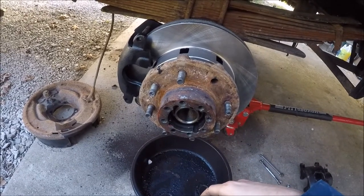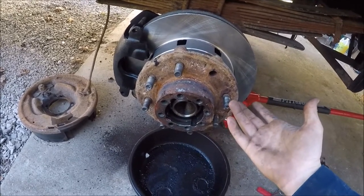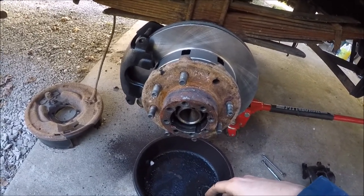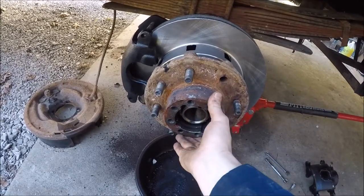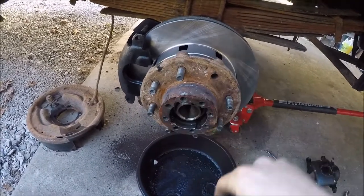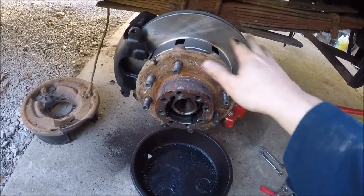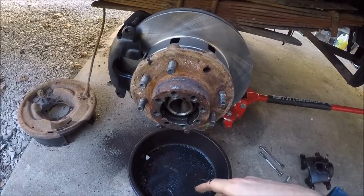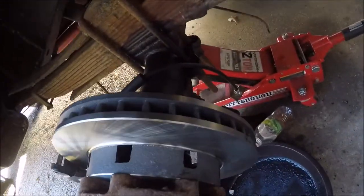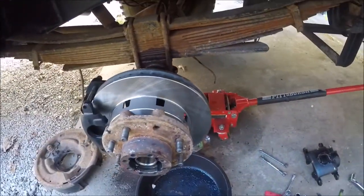So I'm pretty excited about this. I've pretty well decided I probably won't film the other side because it's the same exact thing, just mirrored, and I'm not going to make everybody sit through that. What I am going to do right now is go ahead and pull this back apart, torque the bolts down that are holding the caliper bracket on, clean the spindle up one more time real good, and actually start assembling. Then the next thing will be to route that brake hose around there the way I want it and get the tabs welded.